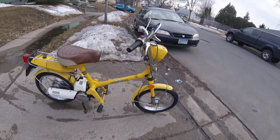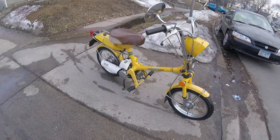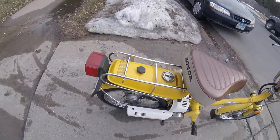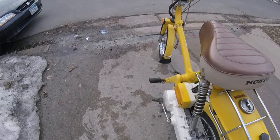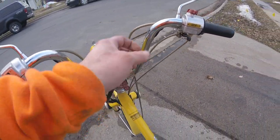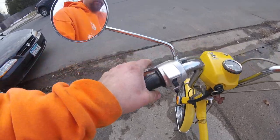It wasn't much wrong with it. Bought it from the original owner. It's a 1978 model, it's an NC50, the Honda Express — very unique scooter. It's spring-loaded, oil injected, which was ahead of its time — no pre-mix, which is really unique. Here's how you start these: you got the key, the kill switch, turn to run, choke over.